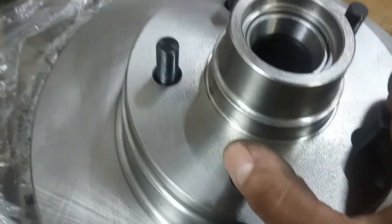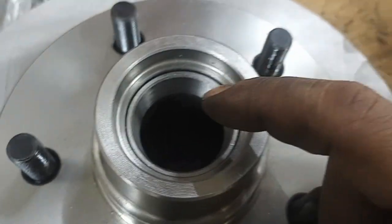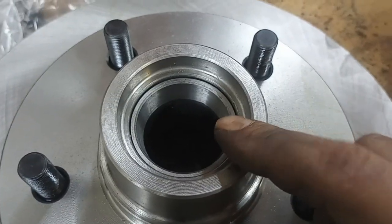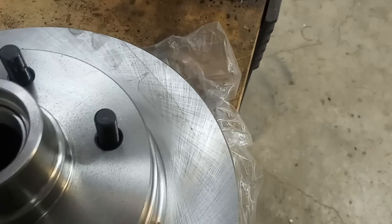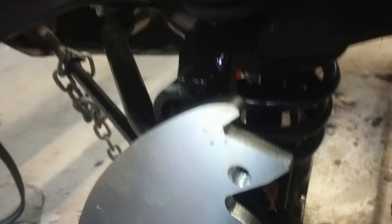So just be careful to triple check. I just drifted that out — no big deal. I've got to do this side and install their bearings and then I'll be able to get it on my spindle. It's my stock spindle, which is cool. You don't have to do anything with spindles with this kit, because I already painted mine. I sandblasted it, cleaned it up. It looks nice, it's ready to go, it's in good shape.